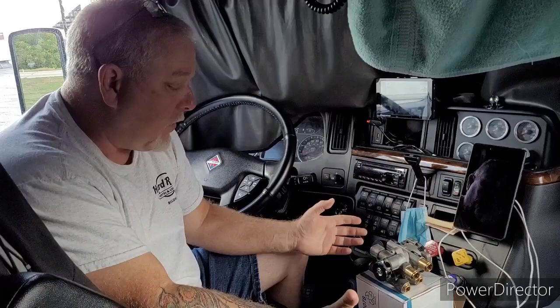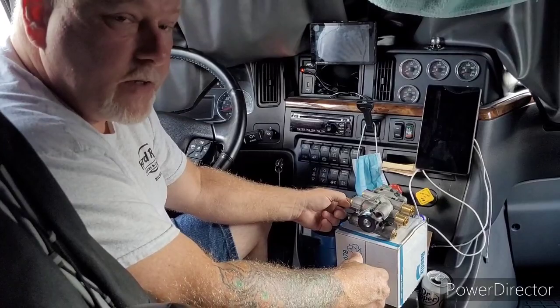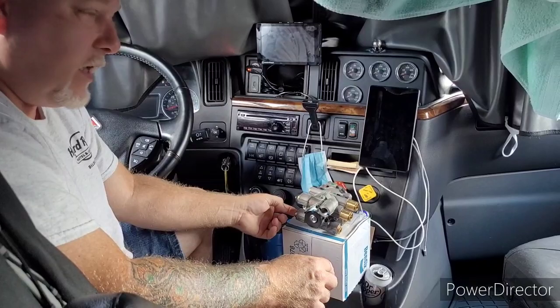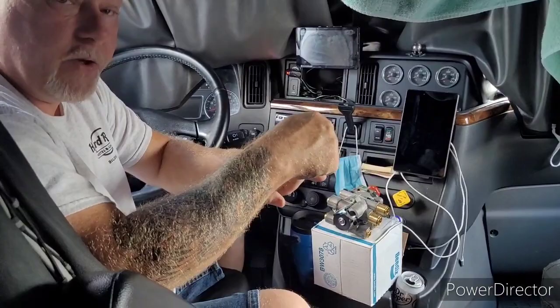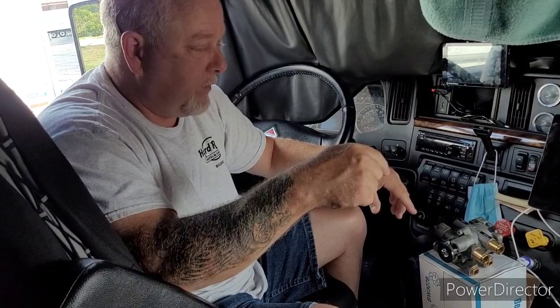After doing that research I got up the following morning. This delivery line has a T in it — one going off this way, one coming down. My research showed that delivery lines should never have air coming back through them — they should only have air going out when you press the brake pedal. What these lines do is go to the relays, and then the relay has its own supply air coming to it. When you push the brake pedal, air comes through the delivery line, pushes down on a diaphragm, and allows the air from the supply side of the relay to flow through the relay and out to the actual brake chamber.